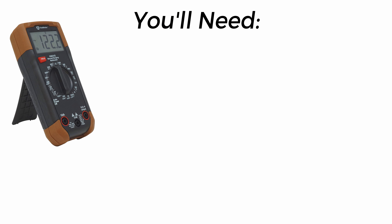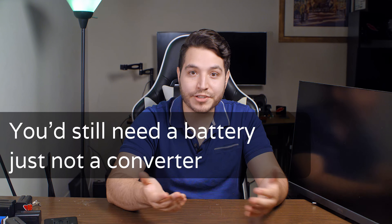The important thing to remember is that if you want your monitor to serve dual purpose on your desk and in the field, you'll need two of the same arms — otherwise one is enough. Now let's make it battery powered. For this, you'll need a multimeter and a DC-to-DC step-up converter, assuming your monitor runs off 19 volts, which most do. If yours runs off 14 to 16 volts you wouldn't need the step-up. These converters can take one voltage and convert it into something higher or lower depending on the type.